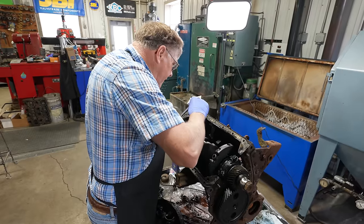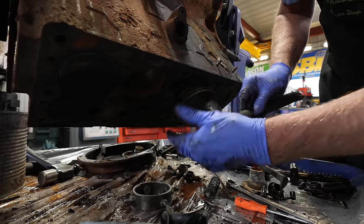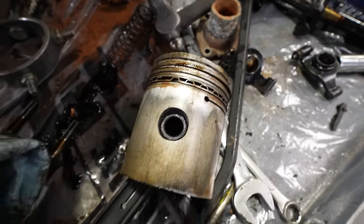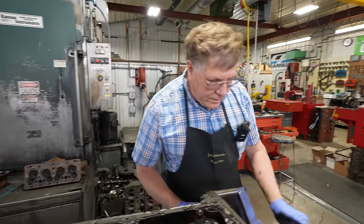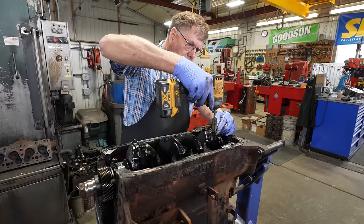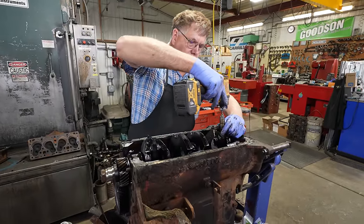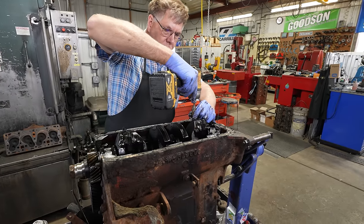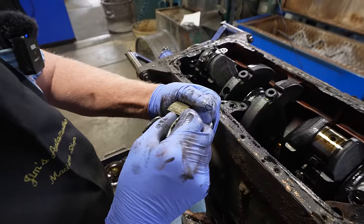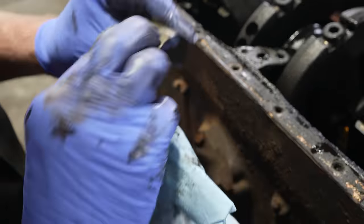I'm up against the ring on the top — that's why it's giving me trouble. Look at this one the same way — quite dry. Yeah, this one really shows. I think that's been hot and actually melted the Babbitt. There's some numbers — CB236M. So that's a Clevite bearing. I'll bet that's standard size. I don't know if they would have been the OEM supplier to this or not. I'm almost thinking those may be the original bearings.